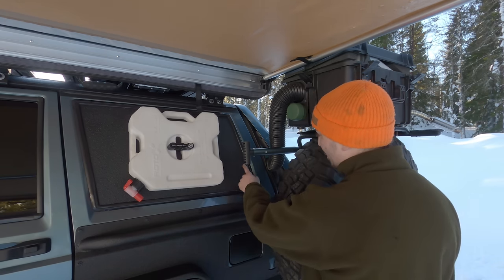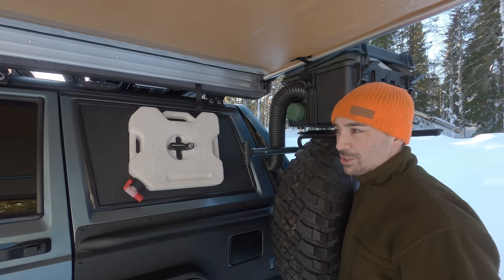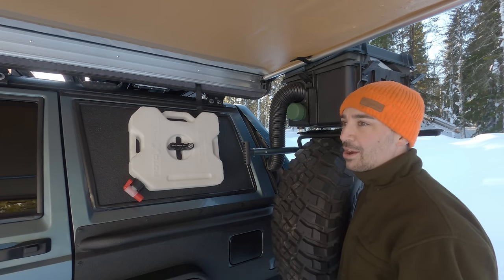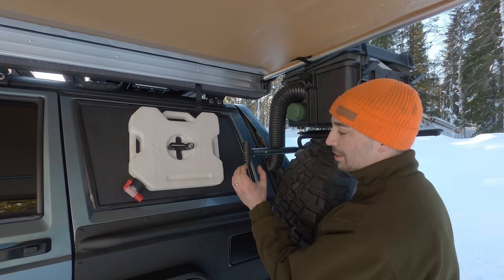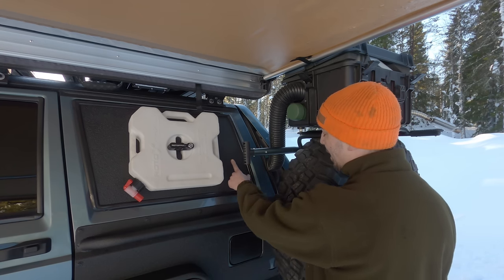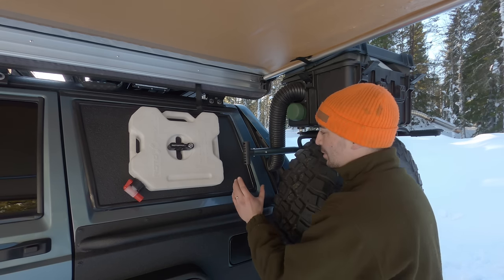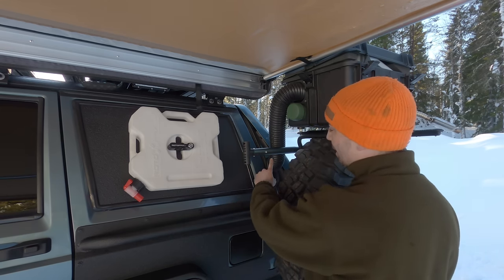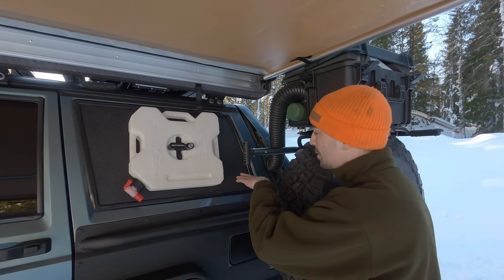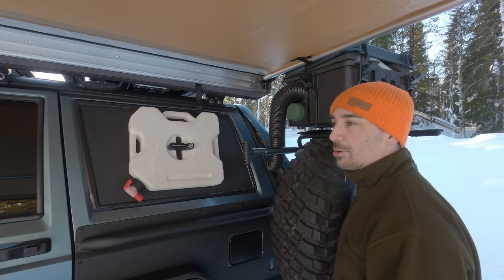But what I'm going to put just here is you get these lockable receivers you can buy that you use to fill water into caravans and stuff, and you can get some pretty big ones so they don't restrict the airflow. I'm going to get one of those put in there, and it's got about a 73 millimeter receiver diameter, which is the same as these duct pipes. So I'm going to be able to keep the hatch closed, unlock it, put the duct in, and just fill the car with hot air.